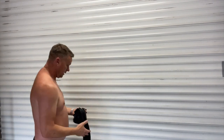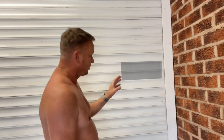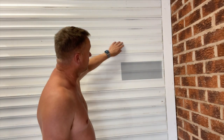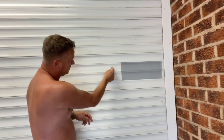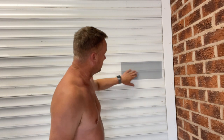It's pretty clean, not too bad at all. I'm not really fussy about getting it completely smooth — as long as it's nice and clean, the paint's going to do the rest of the job for us. As you can see, I did a little tester just to check the colour was right and to see if it would react with the paint already on the doors. These are aluminium louvres, and I wasn't sure whether they're powder coated or originally painted, so I just wanted to make sure our paint wouldn't react. That test spot has been absolutely fine.